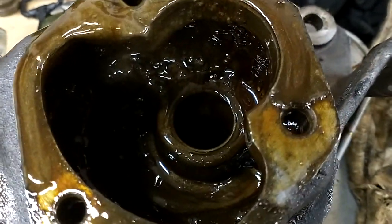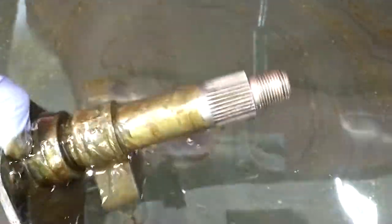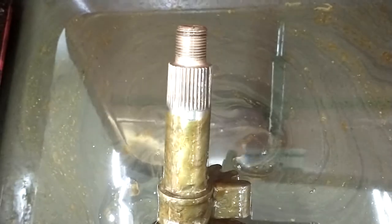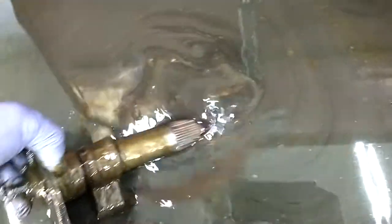I'm going to assume that's wear from the bearings. Over here I've got the gear soaking — that's what the pitman arm goes on, and as you steer the wheel it moves it back and forth. Got to clean that up and get a look at it. It looks pretty good though, nothing stripped on there. I think there's a bushing in there or something.